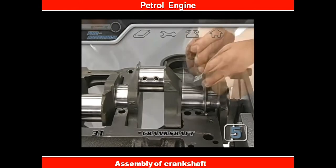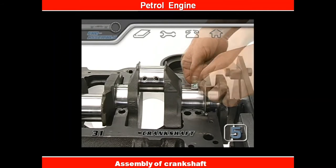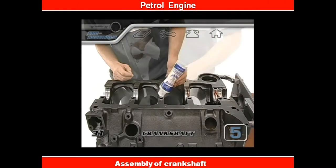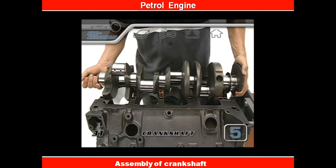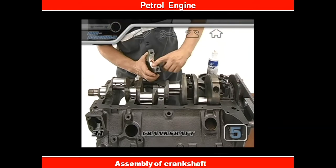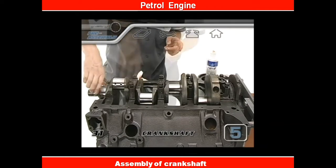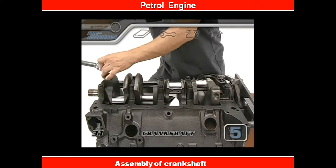The rear main is no different. After you torque in three increments, you're ready to pull them and check the last clearances. If everything checks out with the main bearing clearances, pull the crank out but keep it nearby. Get some lubrication on the bearings, then carefully lower the crank right back in. You're going to get real good at handling the crank because it's going to come out and go back in a few more times. Of course, the bearing shells in the caps will get some oil too. Refer to the marks that you stamped on the caps to make sure that the right ones go in the right place.